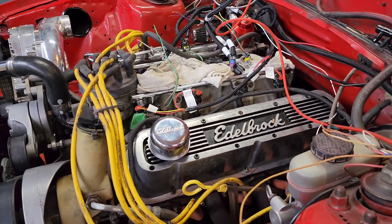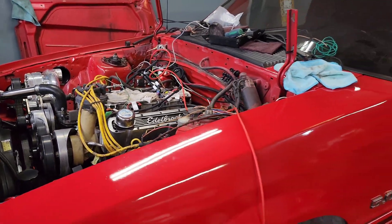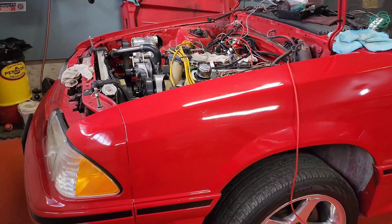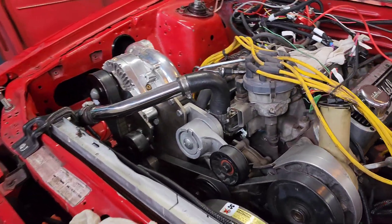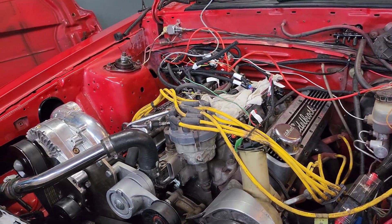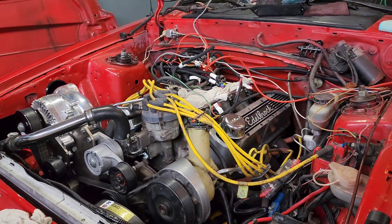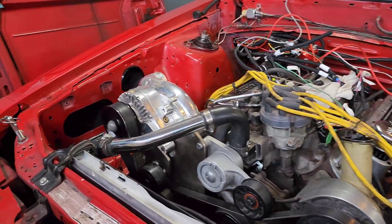I'll give you part numbers to buy the sensors. For me in Canada, it's sometimes more difficult to find sensors — the dollar is never really that good and getting stuff here in a timely manner does add time. I had done a Novi setup here as well with some 60-pound injectors and a stock ECU. For me it made sense getting the Holley so I could at least run a base tune and get the car started in my garage without having to worry about tuning.